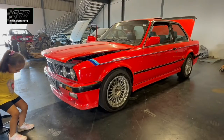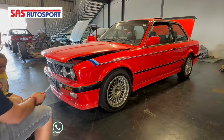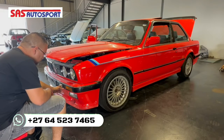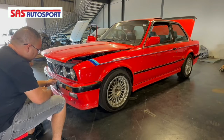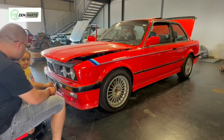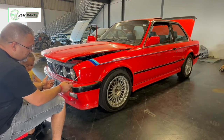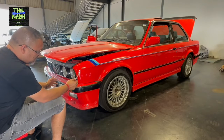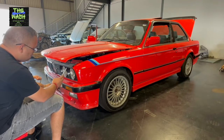Okay, guys, so what we're gonna do is, let's start off by taking off the headlights. Then I'm gonna try and take off the reflectors carefully. Unplug the fog lights. I don't know if there is a valence here behind. Then we can start loosening off the bumper. Again, in theory, there should be the two, I think it's size 13s, on the side of the car, the two 10s in the front, and then we're gonna start.